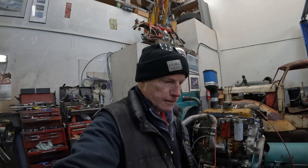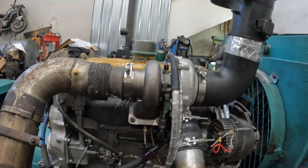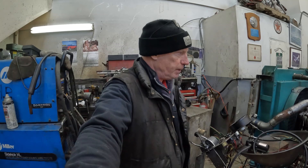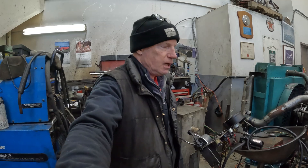There are a few guys out there that have the smaller injectors and they just want to see how this housing responds. It's a pretty sweet setup — stainless steel, a little bit smaller of course than the .82 housing. I'll set everything up and we'll fire the mule up and do another dyno session. Very interested to see how that smaller housing performs. Let's get to it, shall we?